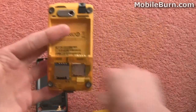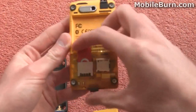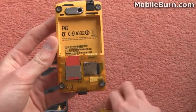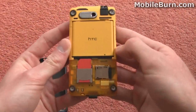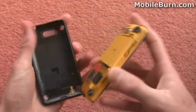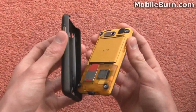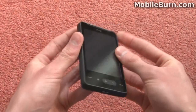So if we just start putting a few different bits and pieces in: the SIM card you can see just slides straight into here, easy. The microSD card just goes straight in the side so we can actually access that without removing the battery. Unfortunately the battery does obscure the SIM card slot so you can't get the SIM card out without removing the battery first. Then all we do is just pop the battery straight back in, bottom first, and then the rear cover just fits on quite easily — it slides in and covers the entire back of the device as well as all the sides.